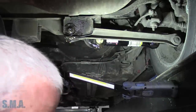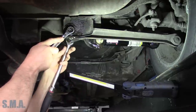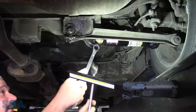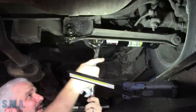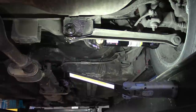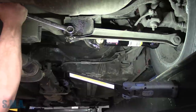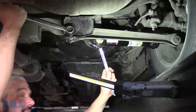We're going to do this on the turn plates rather than elevated, because these bushings need to be loaded once they're tightened — so we want to do this vehicle on the ground. We're going to crack the cam bolts loose; I just put in these new arms and new cam bolts on the front side. Sometimes instead of overthinking it, just move your adjuster and see which way it moves on the screen. Whatever way you think it needs to go, try the opposite.